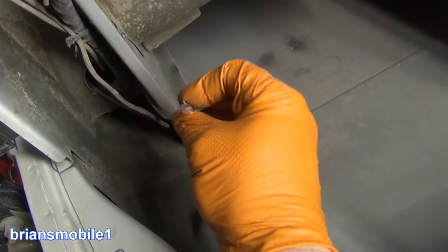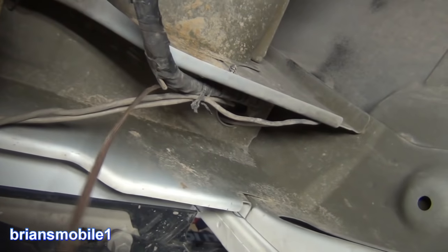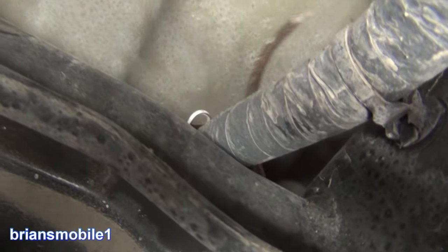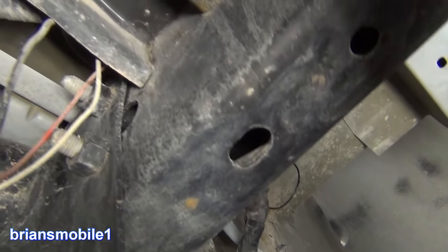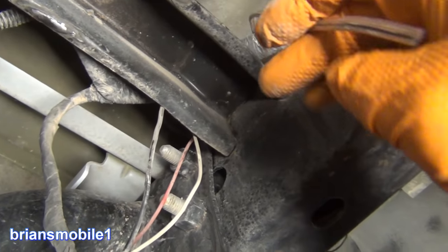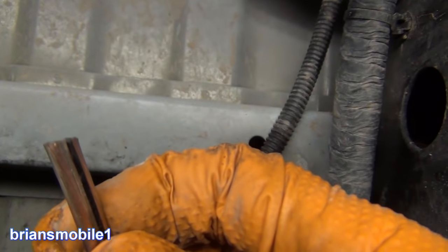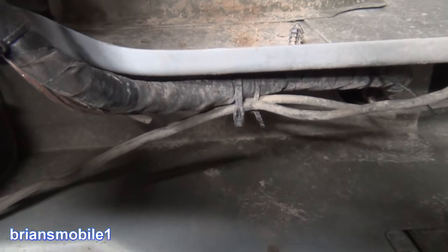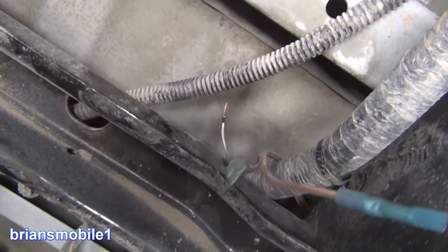Here's my speaker wire sticking out the bottom — think about whether you want to be over or under as you run this. I've got a little pine tree fastener here. Run that up over the top and follow the same harness — that gives you something to zip to as well. You don't want to ground to the bed because if you ever want to pull the bed off you don't want to undo all of that. A self-tapping screw into the side of the frame would be great for a ground. The speaker wire — one side is indicated as ground by a black stripe or sometimes a white stripe on one of them. Make sure your polarity is right on each end.